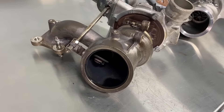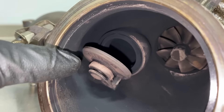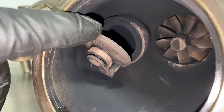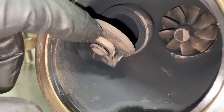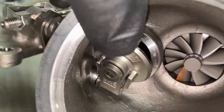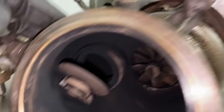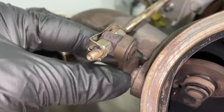The other point where you're going to get noise is the flapper valve itself inside of here. You can see this is made to seat against the bypass for the turbo — that's part of the wastegate system. When it's not being actuated upon deceleration, this opens up and allows it to bypass the turbine on the turbo to drop the boost. So it's just sitting here, not pressed against the housing, and it just flutters in the exhaust gases. You can see how much wear this one has over time. On the new one there's a slightly different design — it's got to be able to pivot, but not this loose.